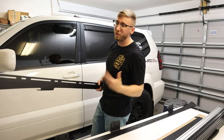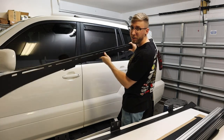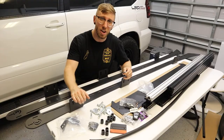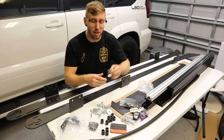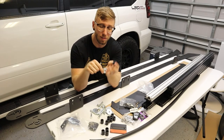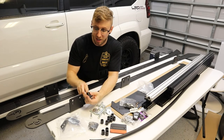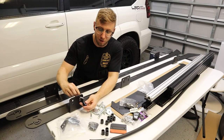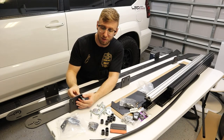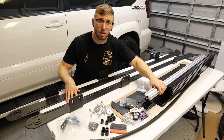My plan of attack is to install the sidebars first, since once they're up they'll give me the ability to line things up properly as an anchor point. All you need for the sidebars are the larger silver bolts, the washer, and the spacers. We'll put a spacer down, thread the bolt and washer through the roof rack piece and through the spacer, then thread into the factory holes already on the roof. We'll do both sides and then worry about the horizontal braces.